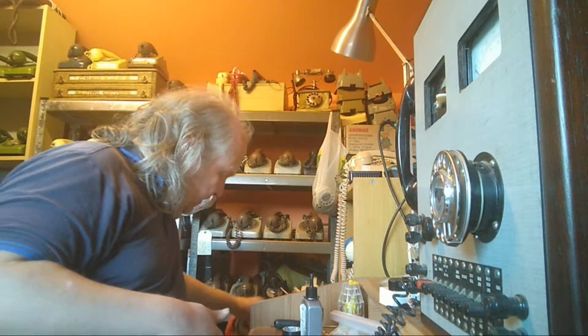That problem is a particular problem if your tapes are made by Ampex. And in the world of video, a lot of the broadcast videotapes were made by Ampex, and it's what they call sticky shed syndrome, and it's a huge problem in the world of archival video and television archives. The BBC estimates that some of their early videotapes they can probably only play 6 times, because so much stuff comes off every pass it has through the videotape machine. So it's a big problem.